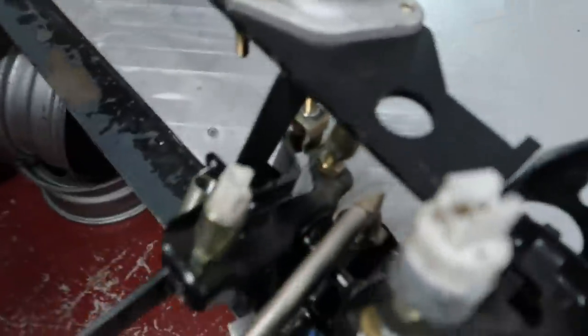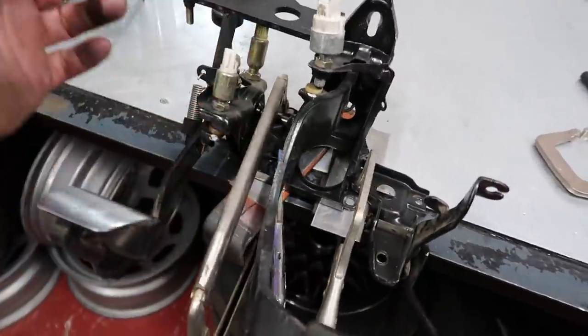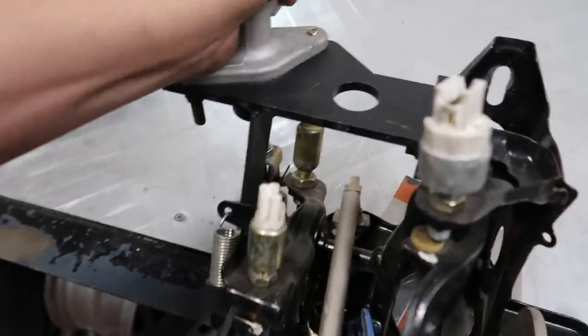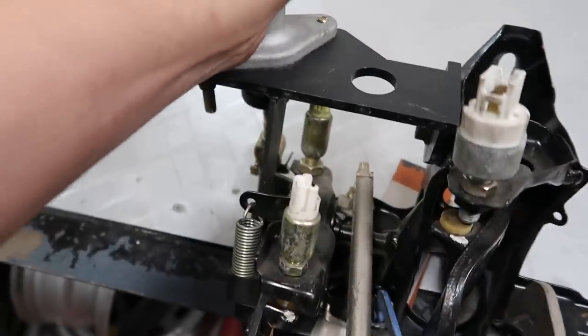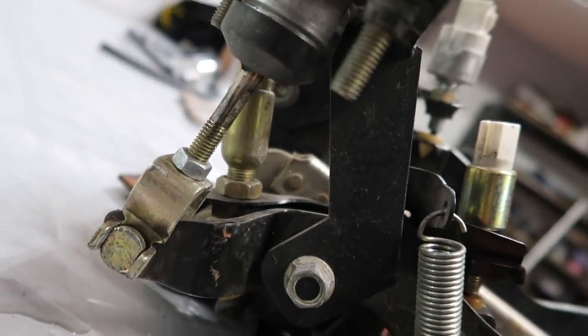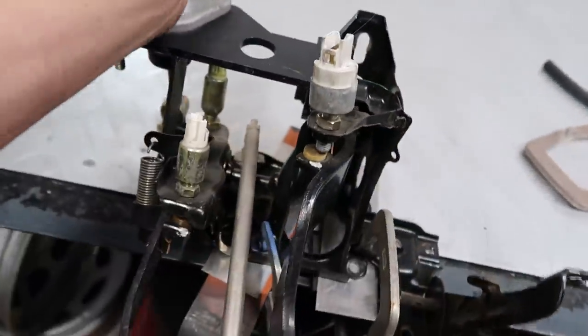Here is the old cable-to-hydro conversion. I got it clamped up on the bench, clamped down good and tight so it doesn't move — to kind of replicate it being bolted up in the car, so I can see how exactly this thing flexes and maybe identify the problem. I don't see anything cracked, but the thing moves a lot. I'm noticing it's not triangulated at all — it's bolted there and bolted there to a point where it can just kind of move.